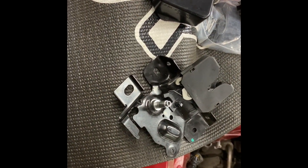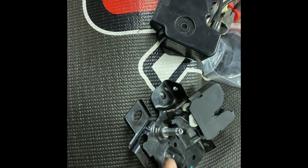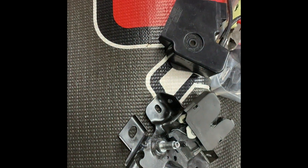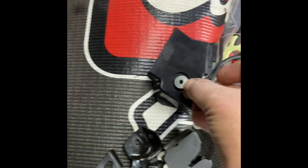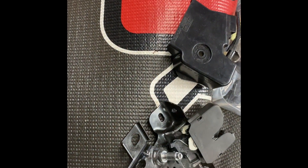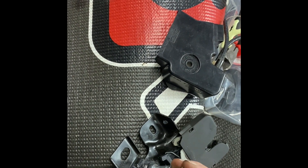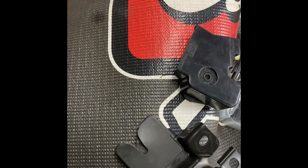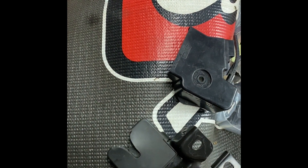A little update here. This is the 07 one - I took it apart. Basically drilled out the rivet head to get the washer off, and then I drilled through it. This is a 4-40 machine screw, so I'm going to use this to bolt it back together. This will go all the way through, so we'll bolt it back together that way.